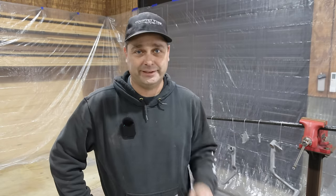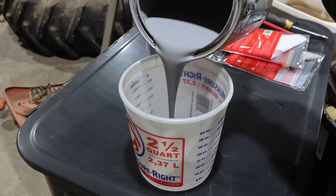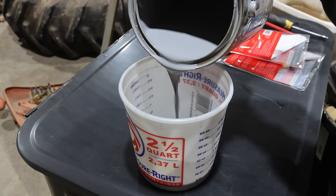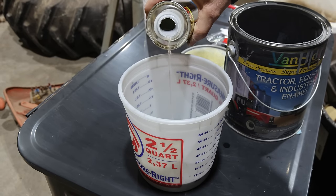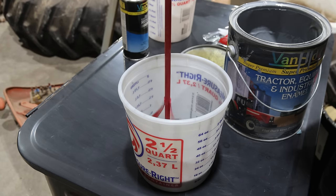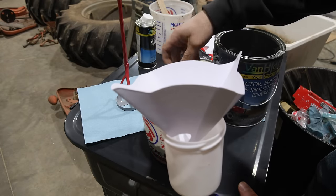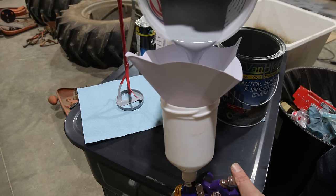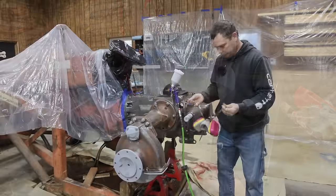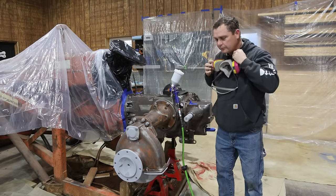The only thing left to do now is finally paint. First coat's going to be primer - we'll go ahead and get that mixed up and get it in the spray gun. We're going to add some reducer so that it can run through a spray paint gun, and we're going to use a paint strainer to put it into the gun because it was a little chunky. I do have a respirator to wear - it's got filters for when you're doing paint.